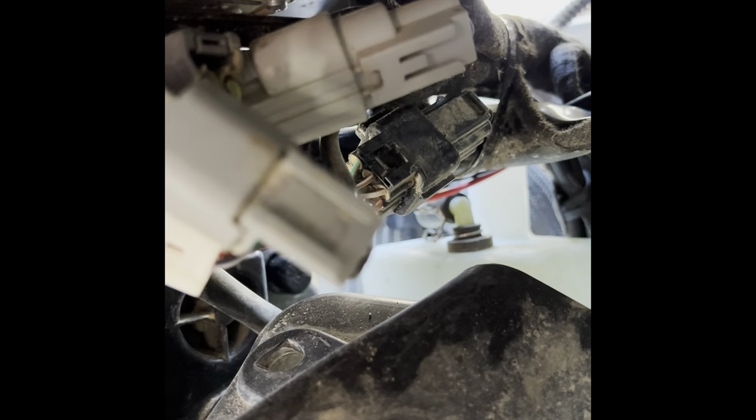I would just follow this wire right here that you can see comes off of your harness for your lights. Just follow this up. It's going to be the middle one, and it's going to be an orange color. I tapped into it right there, crimped it, and used the watertight connector, and then I heat shrunk it. There's glue in it, so that's all sealed up. Then after that, you're done. You just run the wire back up into the middle where the other wire was run from the other side. I'll put this back together and I'll get back to you.